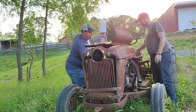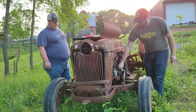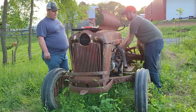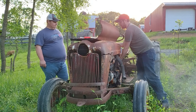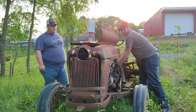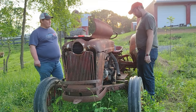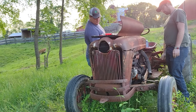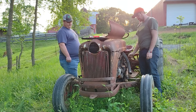Again? And we're pulling gas again. Okay, I'll shut it back down. Okay, go ahead. We shouldn't need ether. Definitely need to get a carburetor kit on the way. Open wide. I think the float's causing our troubles. Turn it on a little bit. That's a little bit. Yes.